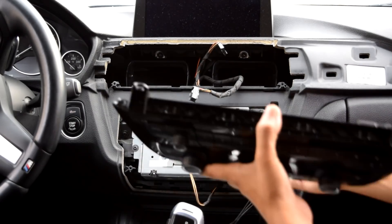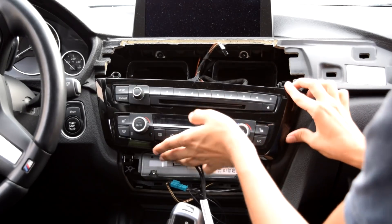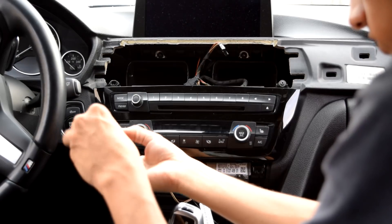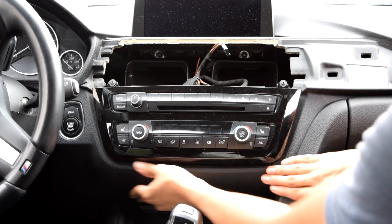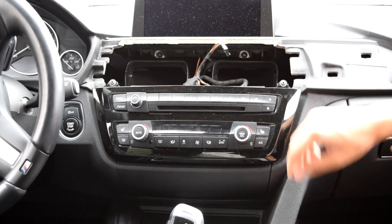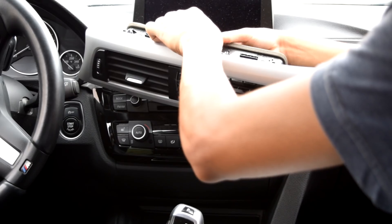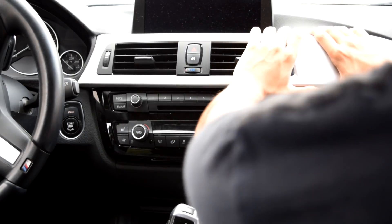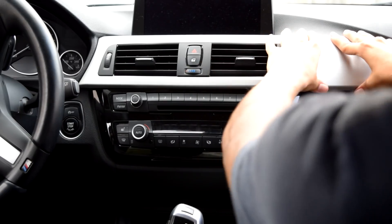This will be the last thing we do — go ahead and tuck these wires in right over here somewhere. Make sure you plug your CD player back in. Go ahead and put the radio in place, grab your four T20 Torx screws and screw them right in. Because of the additional wires it might be hard to tuck this back or clip the trim back into place — if it pops out I'll end up moving that wire behind the radio. Now grab your old trim panel, plug it in, and do the same for the hazard light switch. Once you get that lined up, you should hear it click — and there go my hazard lights, that's how you know it's working. Once you've securely pushed down all the pins and tabs behind the trim piece, you're pretty much done.